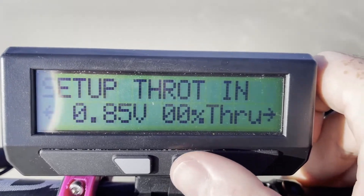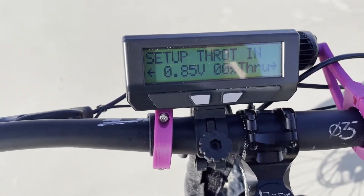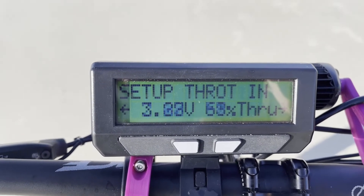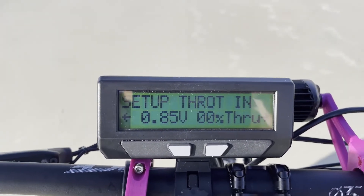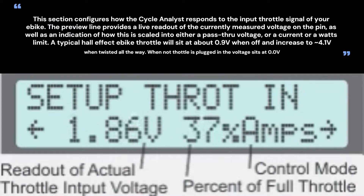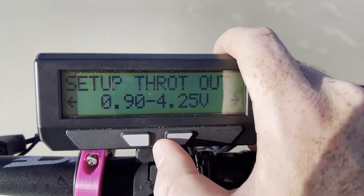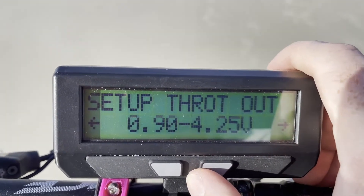That covers the battery setup. The next setup is the throttle calibration menu. In the setup menu you can actually perform this calibration live — when you provide throttle input you can calibrate the full usage range. I can see now that this throttle goes from 0.85V to 4.25V, so the output registers 0 to 99, meaning the throttle has full working range. The throttle output section lets you translate that range: if your controller only takes 1V to 3V, you can translate the input voltage to that output voltage to correspond to a full working throttle range. That's where this is really neat.